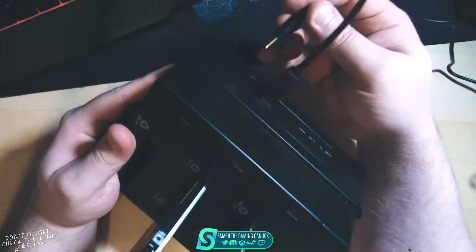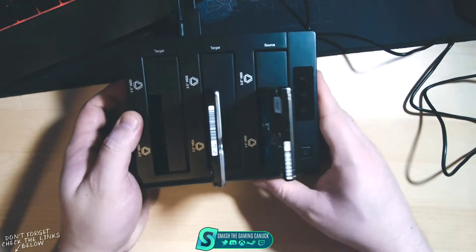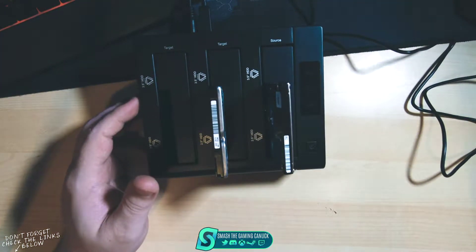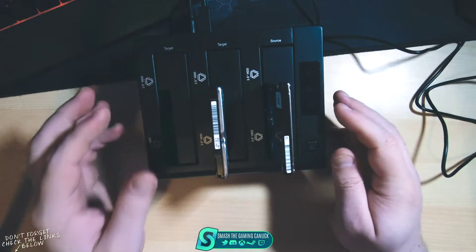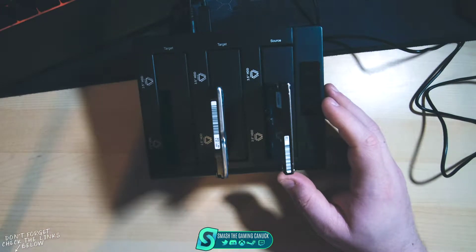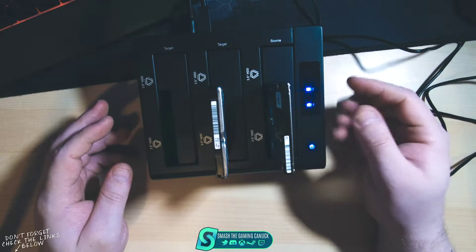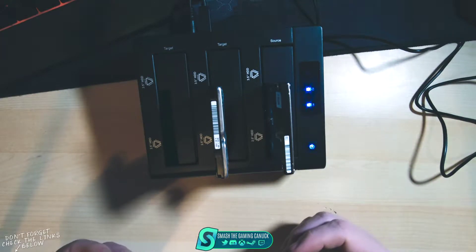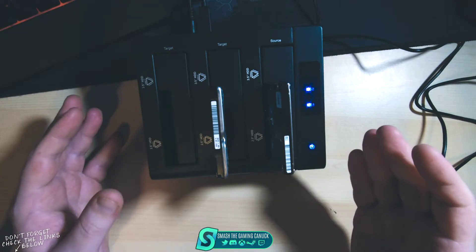This thing does what it says it's supposed to. As you can see, I've plugged it in — make sure you have it on PC mode, not clone, because you don't want to accidentally hit the start button and start cloning. If you have it on clone and yank a drive out mid-process, it'll give you a nasty beep — that doesn't mean your hard drives are messed up. As you can see, all the drives light up blue when detected, then go red as the computer picks them up. It's nice to have that indicator since some docks just do one solid light, which is pretty useless.